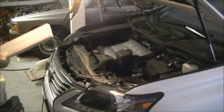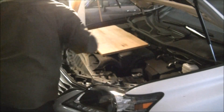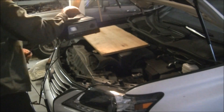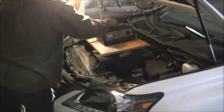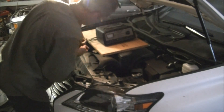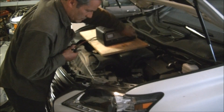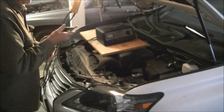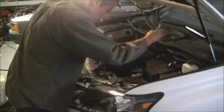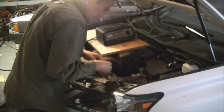In my case, I'm going to use a battery charger as the auxiliary power supply, placing a piece of wood here so the charger doesn't ground out on anything accidentally. The safest thing to do is use another battery, because some chargers don't have a smooth enough current and the car will detect the difference. I've used this charger before a few times and it worked very well, and the cables are much more flexible.